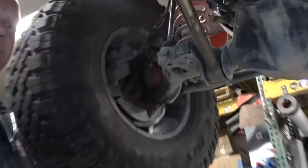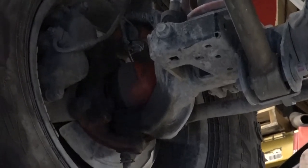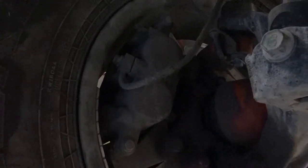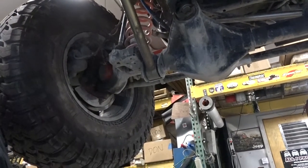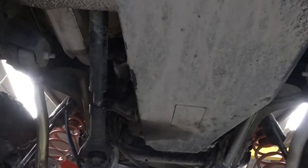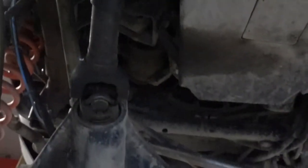Also at the front, we've got the Black Magic Brakes 17-inch big brake kit with dual piston caliper, big rotors. With this much Jeep, this sucker's 6,000 pounds basically without people and without gear. So we needed more brakes, so we've got the Black Magic brake kit. Thing works awesome. Then, of course, up here at the front, we've got a JE Reel driveline. We've been using JE Reel drive shafts for close to 21, 22 years. And this drive shaft has been in here since 2007. This is the original drive shaft I got from 2007.